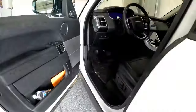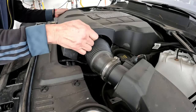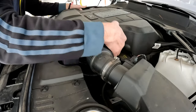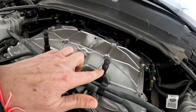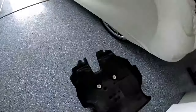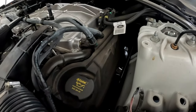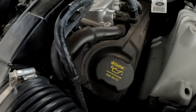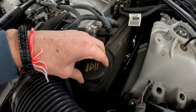Time to pop open the hood. I'll take off this plastic cover that snaps off — these two prongs snap onto the two white plugs, that's all that's holding on the plastic engine cover. The oil cap tells you what type of oil to put in. I'm going to loosen this cap so when I take off the drain plug the oil comes out smooth.